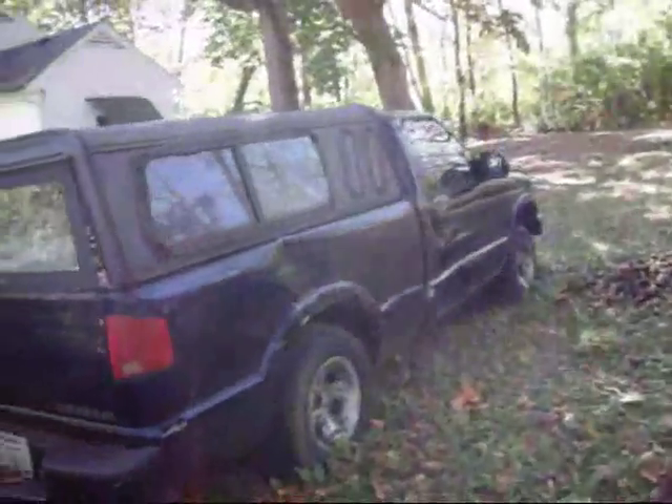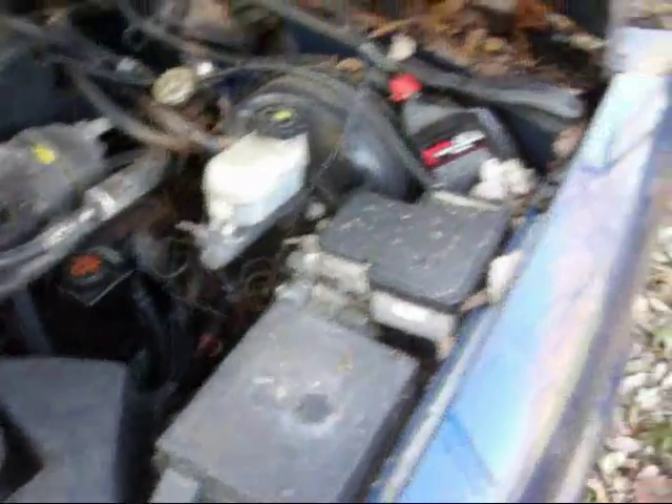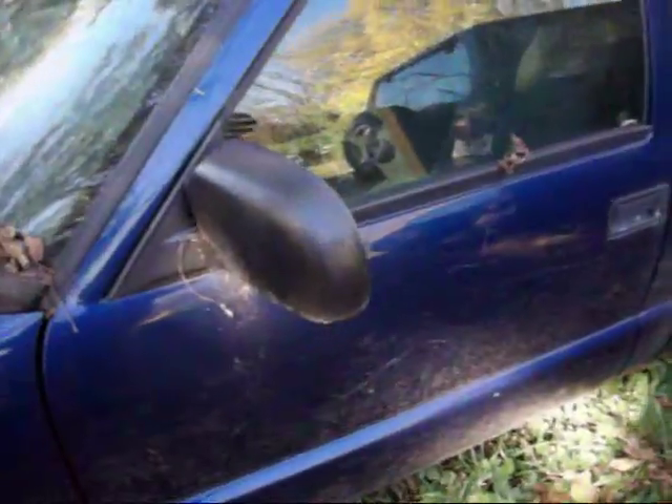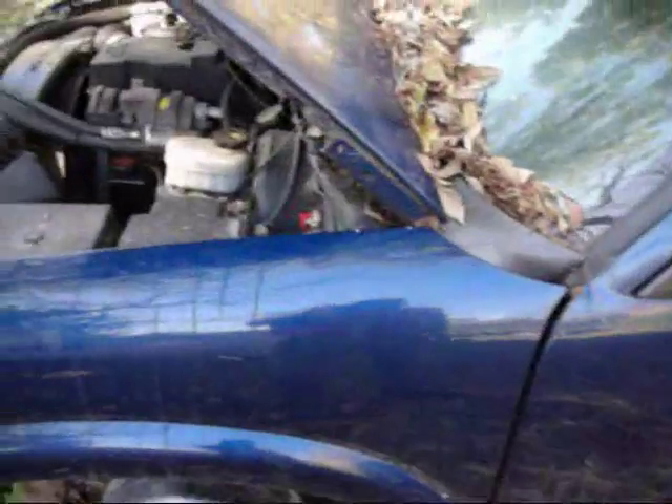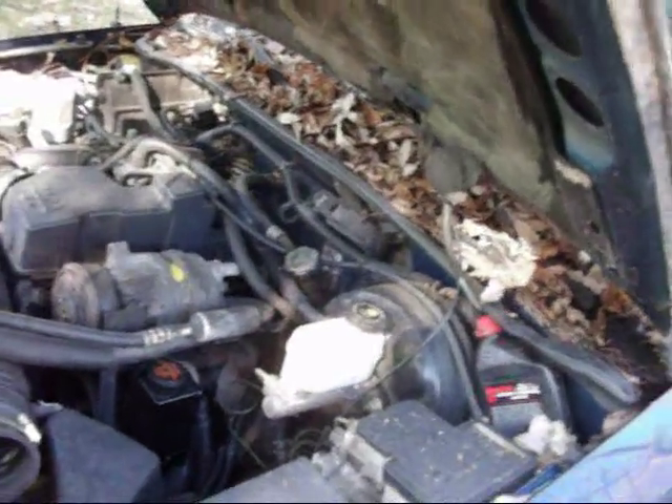I think I'll actually take the alternator out of this S10, because this S10 is going to be my reverse trike when I get time. I'm going to take the whole frame and everything off — the motor runs but it's just got a leaking head gasket. There's lots of good stuff in here I'm going to salvage. Basically I'm going to strip it down to the frame, cut and bend the back end into a V shape, leave the front end with the suspension and steering, put the seats in, and try to put a motorcycle on the back — so I have a reverse trike with one wheel in the back and two in the front. But that's a project for later. Right now I can also take the windshield wiper motor off it and hook it up to a hacksaw to make a power hacksaw.